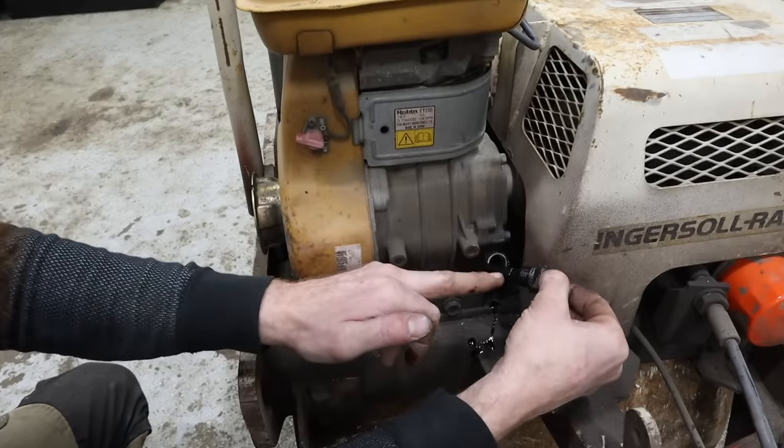Not a lot. Let's take this off. Yeah, we're definitely getting some dirt and debris. See all those little pieces in there? All that little stuff would definitely clog up a carb. So we're going to probably put this back in there and fill it with some actual clean gas, shake it, and then see what it looks like afterwards.